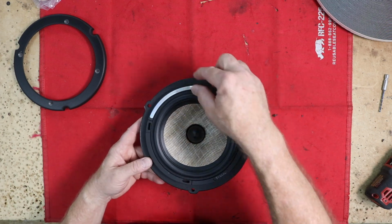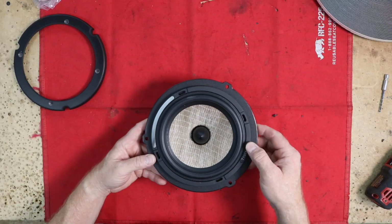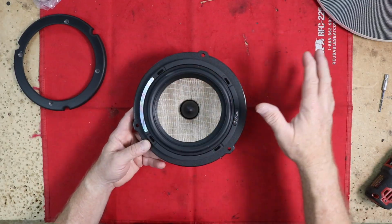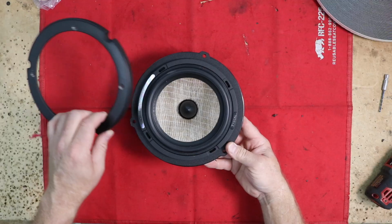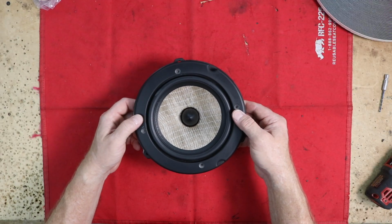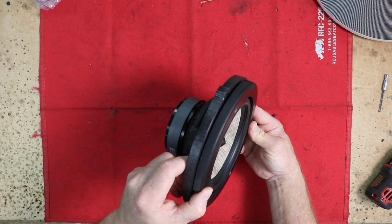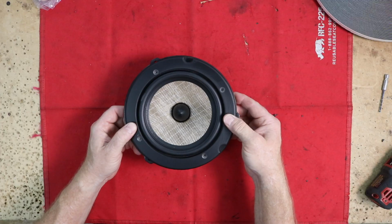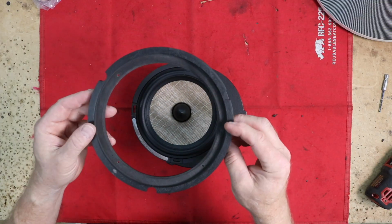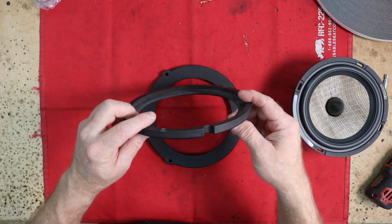Now the foam is going to either have to sit on this, because if we put it all the way out here, as we saw earlier when we put the grill over it, it would totally miss it and defeat the point. Whereas if we use this style installation, now we can put the foam up here on top of it next to this. That's gonna get us a much nicer in-car sound. Now to do this, we made this out of a piece of 1/2" expanded PVC, Sintra or Palight, you can call it whatever you like.